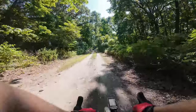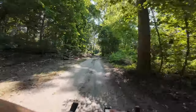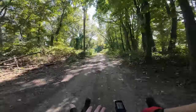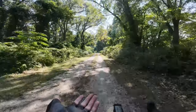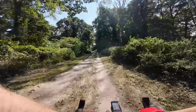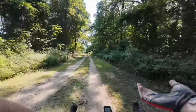He's got me rethinking the rim brakes. And I've got to say, I've got a giant TCR disc brake bike that can only fit a 30 millimeter tire. And when you have a bike like the Trek Emonda, I think they discontinued it, but on Trek's website, the disc brake model can only fit 28 millimeter wide tires. What's the point of having disc brakes then? If you can fit a 32 mil tire with the disc brakes, or 35, now it starts to make sense.